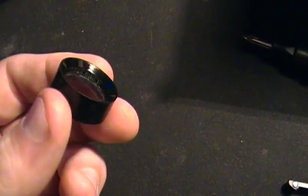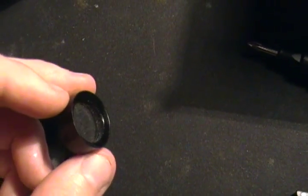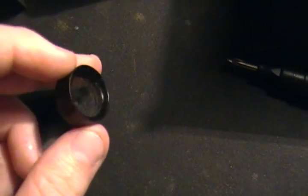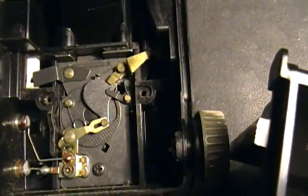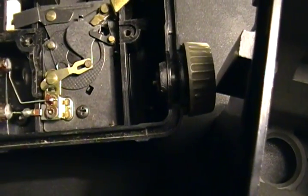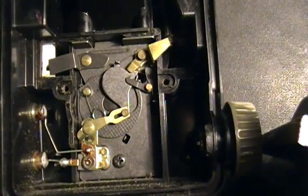Here's the lens element. Make sure you stick it in the right way, the correct way, because if it's concave the other way you're going to get a different effect, which some people like. But for this sake, since I'm taking it apart and cleaning it, I want to do at least one roll and make it back to original. So this in here I'm not going to mess with. I saw something about how intricate it is in here — I know it really isn't that bad, but I'm not going to fool with it.